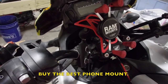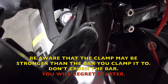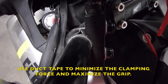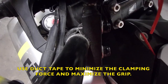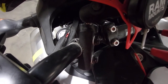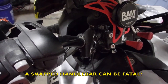My RAM mount is on a U-clamp — you can see it right there, and that is really locked down. I don't like using U-clamps on handlebars because handlebars are generally hollow and U-clamps are solid. When you torque that down with a wrench, you can actually dent the handlebar and weaken it. That's the last thing you want because if you get into a serious crash, you could wind up snapping off your handlebar. I've actually had my gut punctured by a handlebar — it went through my belly bag, through several layers of rubber and leather. I could have died.